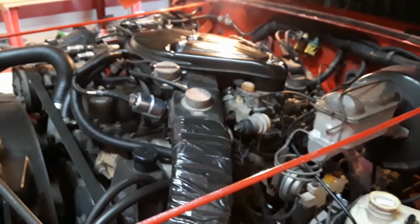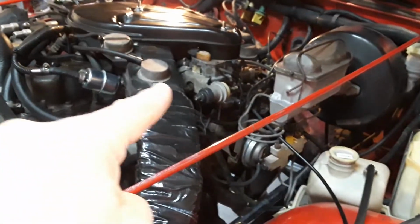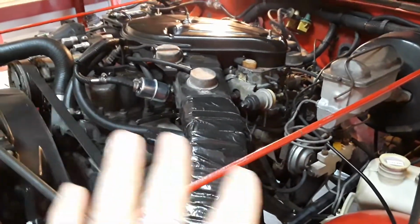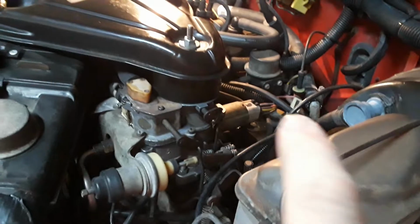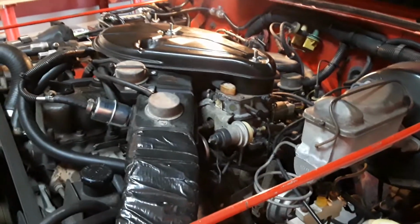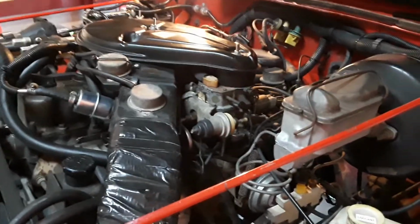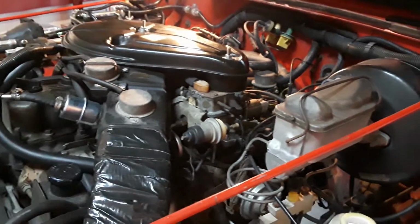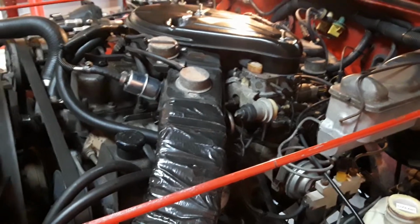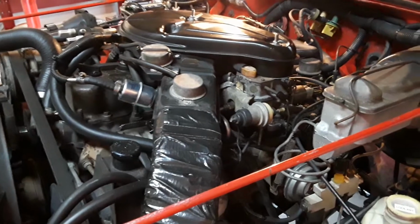And one more thing I want to mention, as I have in previous videos. This has the factory carburetor with the factory emissions all intact, all the factory wiring, the factory stepper motor, the factory computers hooked up, and the Nutter bypass has not been done up to this point. That's what I'm trying to avoid. I know it's very simple to do, but by correcting these issues, it's correcting everything about the electrical system, how it operates and everything.